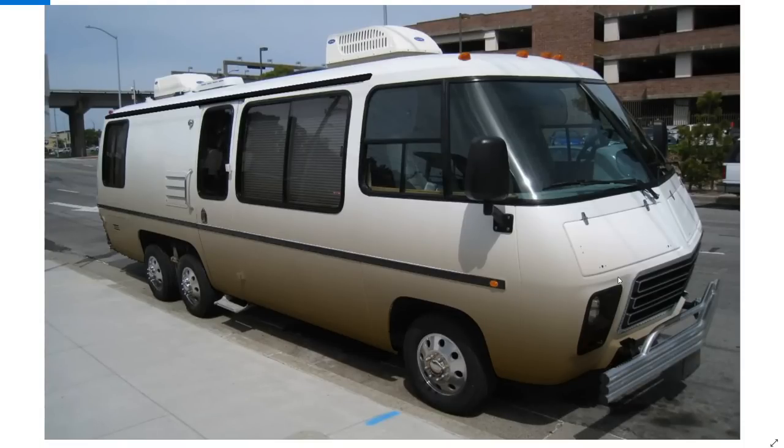One last thing — let's talk about the planned paint job. This is both performative and looks good. I've never seen a fade like this in all the photos of this motorhome's cult following, and I think it looks really classy. It's also going to be cool in the sun — when the roof is all white and white almost all the way down, with the dark color starting below the belly band where the motorhome starts to curve underneath, you won't get much radiant heat from the sun hitting the sides down low.